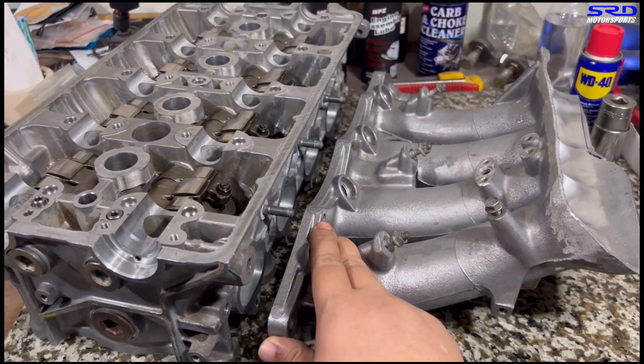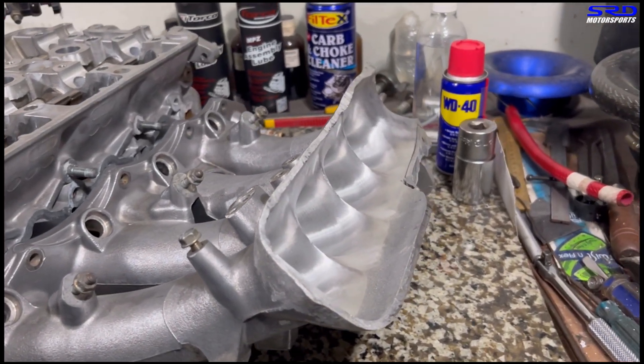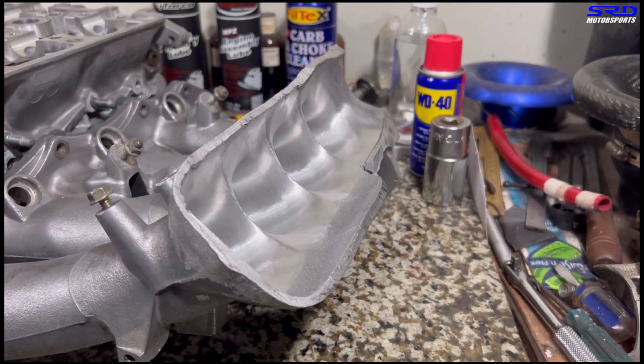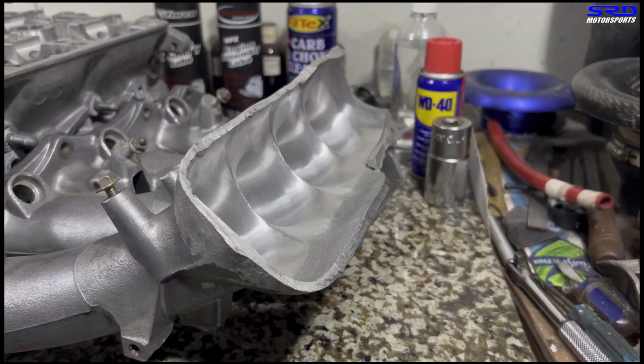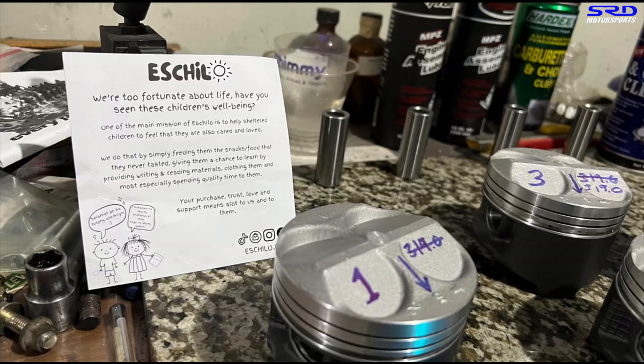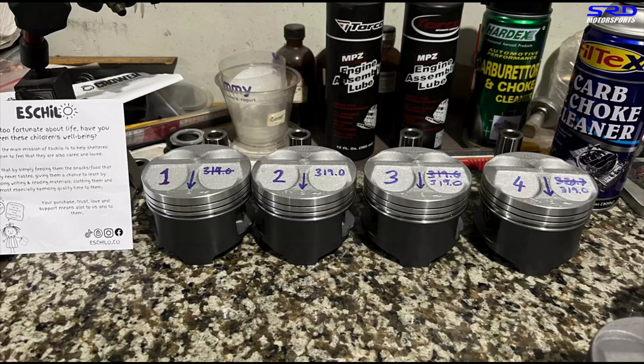Here's the opening of the runners — the runner entry. On the previous episode we talked about making the flow even better, as good as we can, to compensate for the lack of ITR cam. Here we are balancing the CTR pistons — this is at Shilo, actually. This past Friday they did the charity work where we donated school supplies for kids. The result: 319 grams, identical across all four pistons.